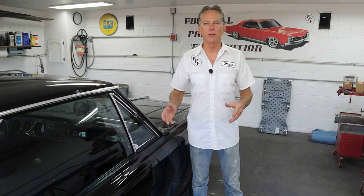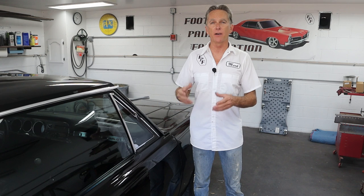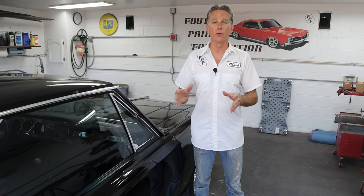That just about wraps up this video on getting the Muncie 4-speed to quiet down in fourth gear. That transmission was good when I pulled it out - it was just leaking out of the counter shaft, it was loose, some seal problems, and the back bushing was shot. Put some new parts in it, put it back in, and all of a sudden I got a fourth gear noise cruising. There's something I did obviously that caused it, but it turns out it was just input shaft - too much end play in the input shaft. Max is supposed to be 25 thousandths, we were at 55 thousandths - 30 thousandths is quite a bit. We got it down to 16 thousandths and it's shifting really, really good. I love the way this car shifts, and it's nice and quiet in all gears - acceleration, deceleration, even reverse. Thanks for joining me here at Foothill Paint and Fabrication. Don't forget to hit the like and subscribe button and mash that bell icon so you get notifications every time I release a new video. We'll see you on the next one.